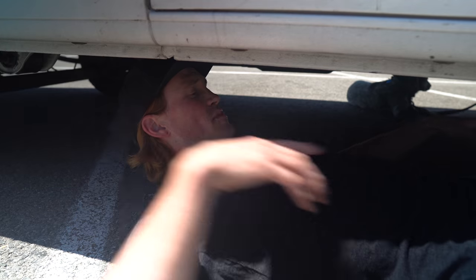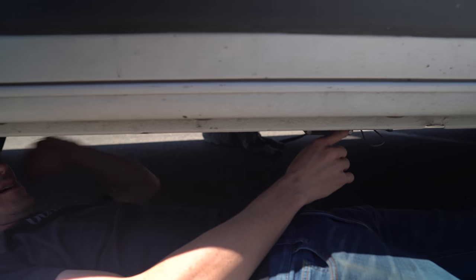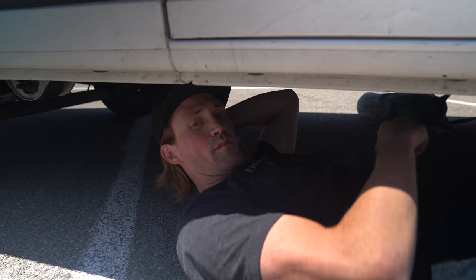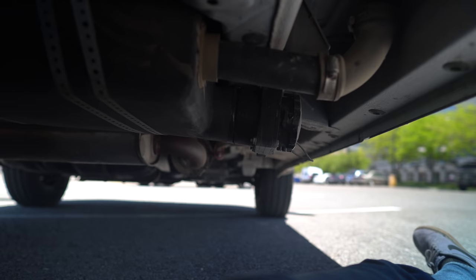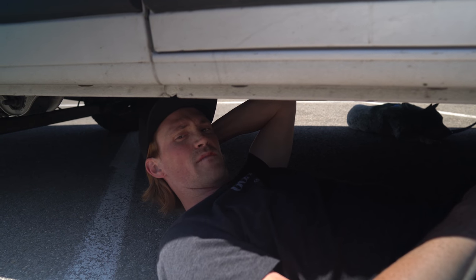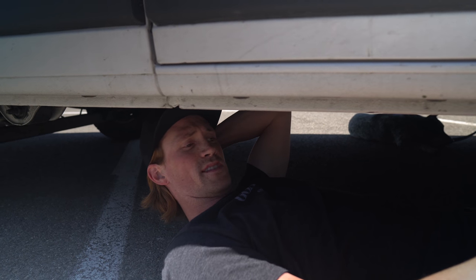so under here is where the gray tank is mounted. It actually dumps right out here, so I put an RV dump valve on the end of the holding tank. This is where the sink and the shower both drain into. I used 6 pieces of strap here screwed into the frame. I got it from plasticmart.com. If you wanna go there, they have like a billion different shapes and sizes.